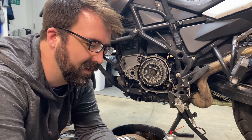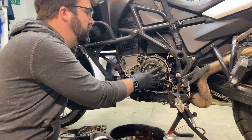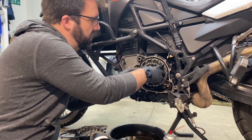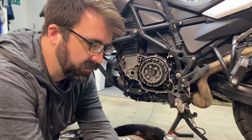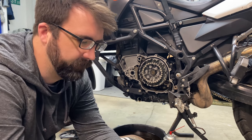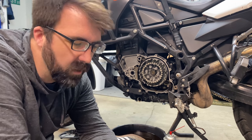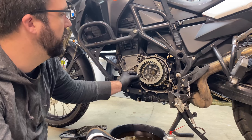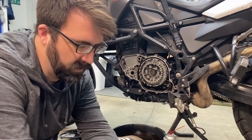For me it was the one I could get quickly since I commute daily on my F800. It also comes with a little bit heavier duty springs, which will be nice — a little better clutch pull and more grip. It came with all new steel plates too. My steel plates weren't in terrible shape but knowing what they went through, and none of them are discolored or worn beyond spec, the kit just came with them so we're going with it.